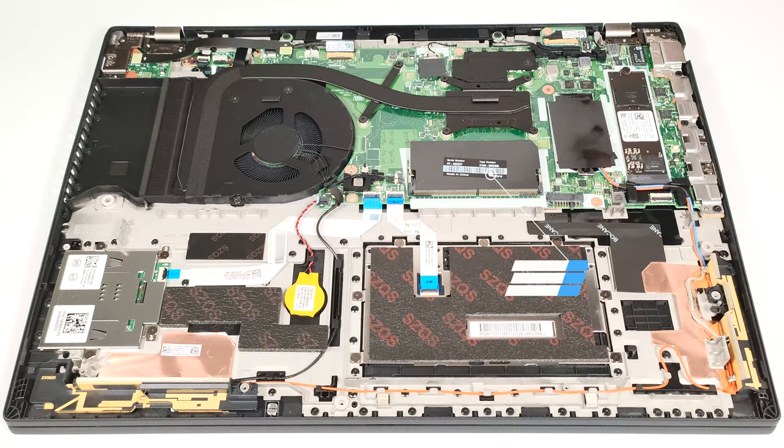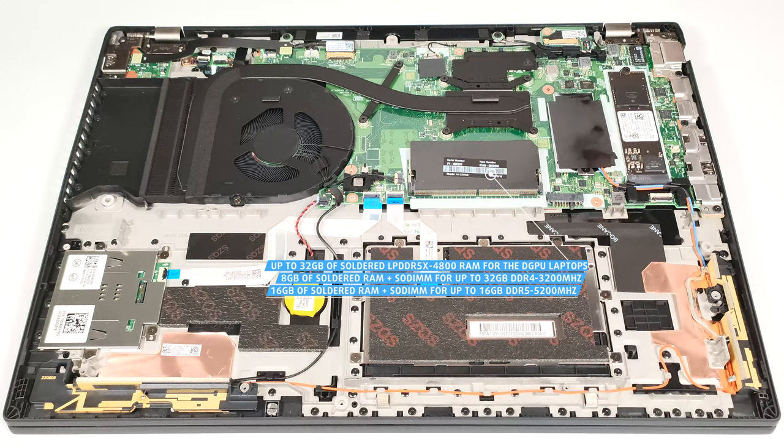The devices with discrete graphics solely rely on 16 or 32 gigabytes of soldered LPDDR5X, 4800 megahertz memory. The iGPU-only models have a SODIMM and can be found with 2 different RAM versions. The DDR4-based machines have 8 gigabytes of soldered RAM, while the iterations with the newer DDR5 memory boast 16 gigabytes